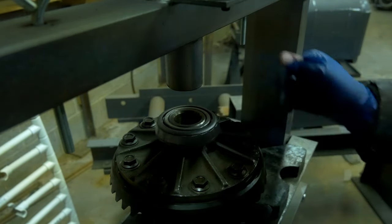You're gonna have to measure your shims in your case, as all this stuff was cast parts. They're not precision, and that's why they have different shims in them. So my shims may not be the exact same size shim that you have. You're just gonna have to measure with what you end up with as you take it apart. So I hope that helps give a little insight onto what's going on with the carrier preload, the preload on the carrier bearings, the preload on the pinion bearings. And then what we'll get to later on is the backlash and how that's really, really important as well.